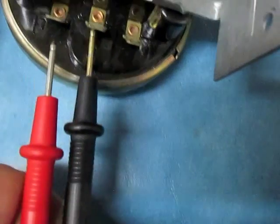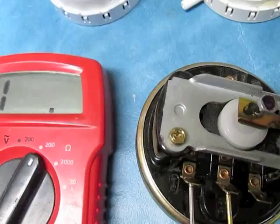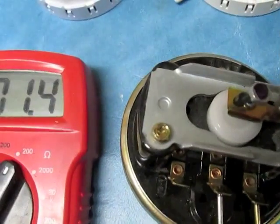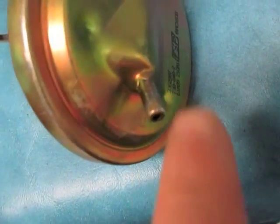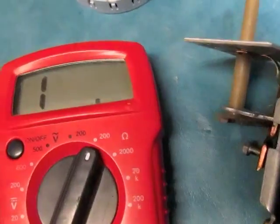You're going to take your multimeter probes and touch the first two tabs. I'm not getting a reading, so I'm going to slide over to the other two. Here I'm getting a reading of about one, which is good. Next, I'll make sure I'm still connected to those probes and blow onto the air intake — that should open the circuit, turning off the switch.